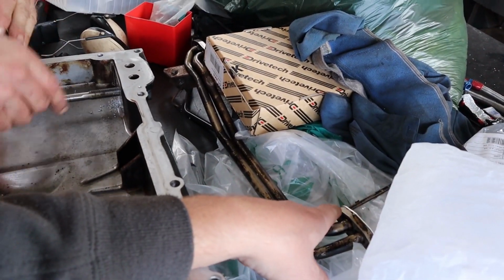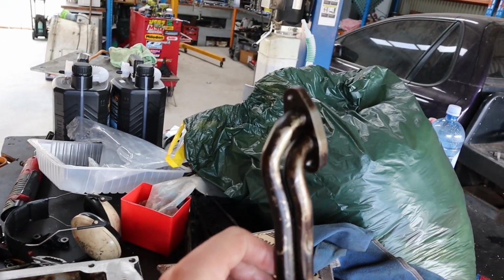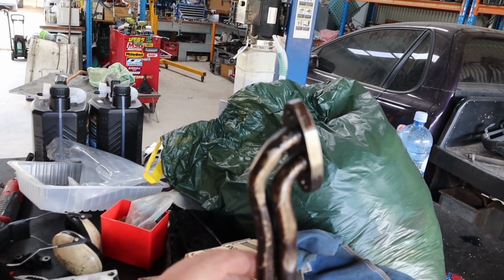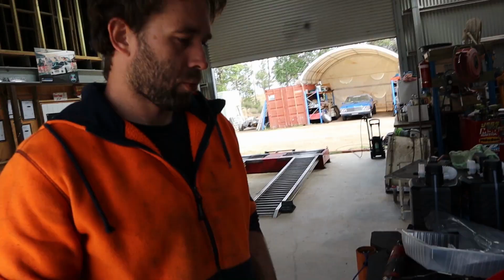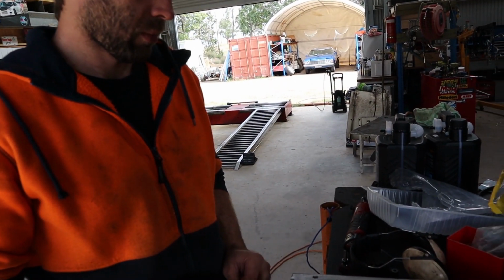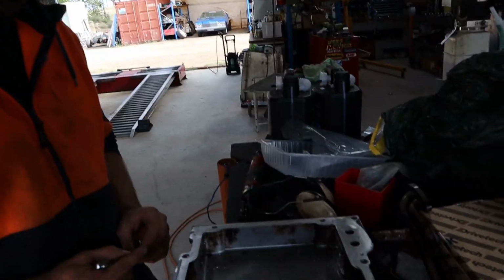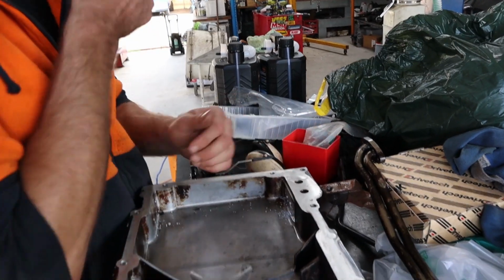Yeah. That's for that side? Oh, yeah, they do. They're designed to thread into the tube, so we're going to need to come up with some sort of solution for that. Can we tap them on the outside? I suppose then you'd have to drill out the block, wouldn't you, to fit the bigger bolt that you're going to have to tap it for. Something else to think about and sort out.